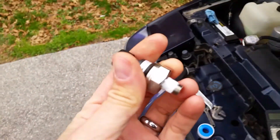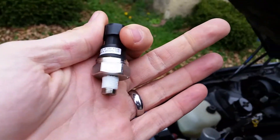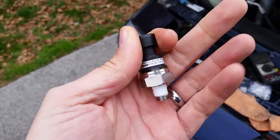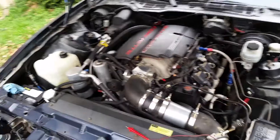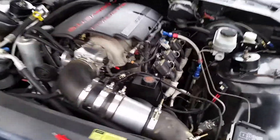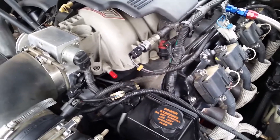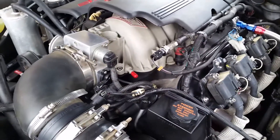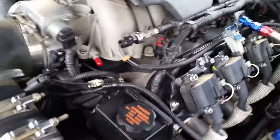And it was also 5 volts on the reference, so I knew my voltage was good and my ground was good — that just meant the sender was telling the gauge the wrong pressure. Depending on your gauge, whether it's 0 to 15 psi or 0 to 50, you can find the voltage range — almost every sensor will have a spec on that. The replacement sender from Auto Meter is $100. They wanted me to send it back for testing and then give me a discount on a new one, but I bought this in 2006 so it just wasn't worth it.